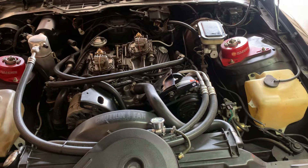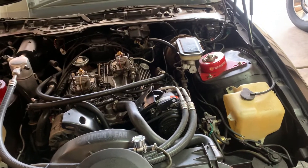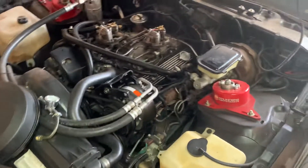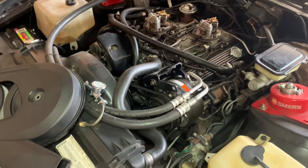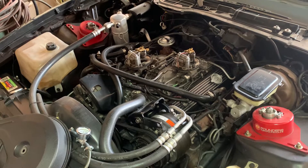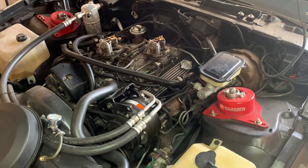So any increase in pressure — if you've got a 20, 25-year-old regulator diaphragm in there, there's a chance it may not hold; it may leak. Back in the day, one of the things to do for these was to put an '85-and-up tune port fuel pump in there. But 9 out of 10 times you're still going to be stuck with 10 to 11 PSI, because your volume is just going to be increased — that regulator is still going to be pre-set at around 10 to 11 PSI. You can do both, but I've always had luck just cranking the fuel pressure up with the stock Crossfire fuel pump.